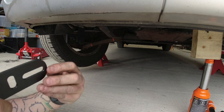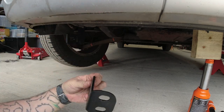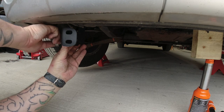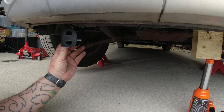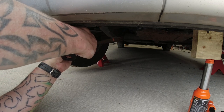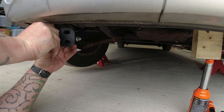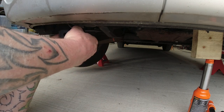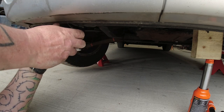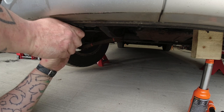These brackets, right, they go on the outside and face inwards. So this bracket is this way and it goes to the outside and you put a nut and a bolt on. As simple as that, in both holes. So I put one this side, and with the way they've elongated the holes, you have two points of adjustment. So this bracket will adjust up and down on both axles, and then backwards and forwards on both as well.